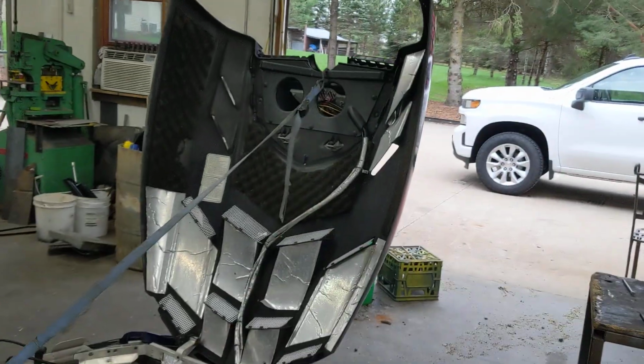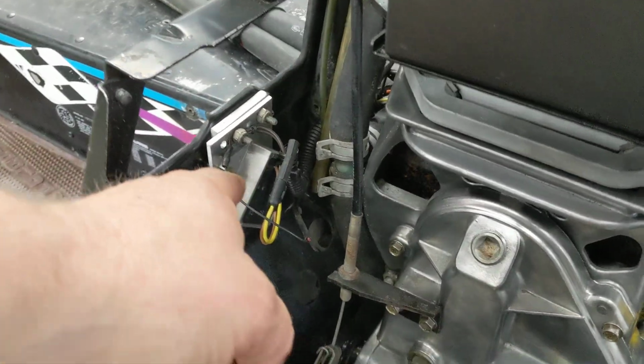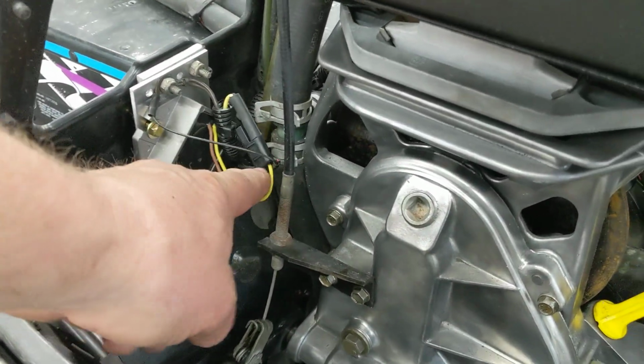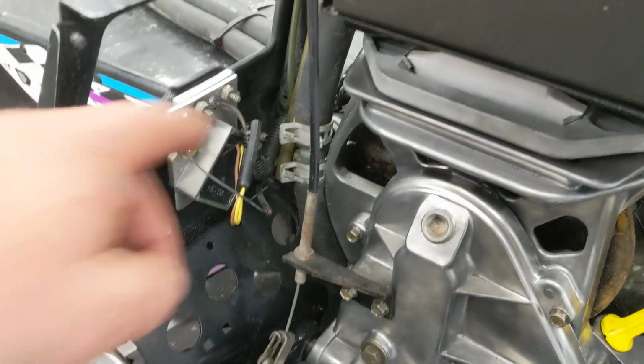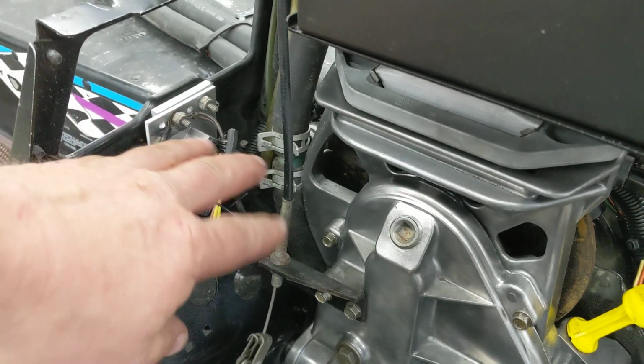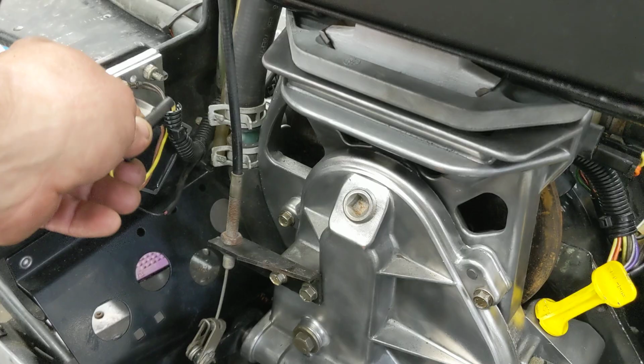And I got one other tip and trick. So I've upgraded the voltage regulator in this thing. Put a newer style voltage regulator in. It's a 2-wire. You only need to hook to the 1 on the 90s sleds. But this goes back to any sled that has a voltage regulator, because you just have to use your 1 yellow wire is all you're using.